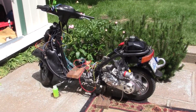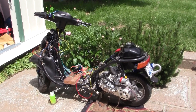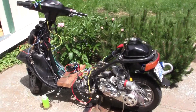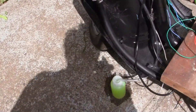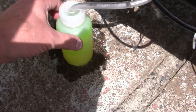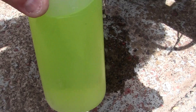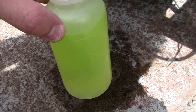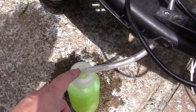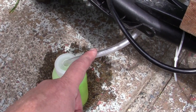What you need to remember is there are air bubbles in the head right now. The radiator is trying to sort it out. What the radiator will do is blow bubbles — I filled this up with antifreeze and it will blow bubbles in here. You can see the bubbles. What it's doing is getting the air out of the system. But this overflow bottle needs to be immersed so no air gets in this line.